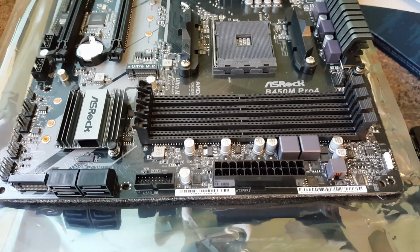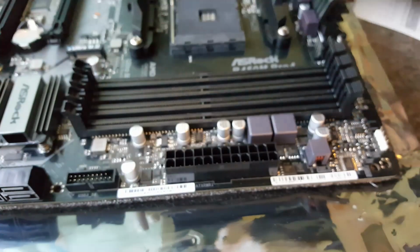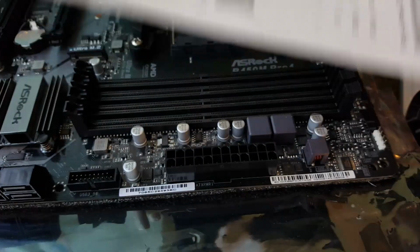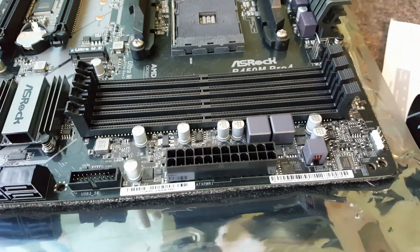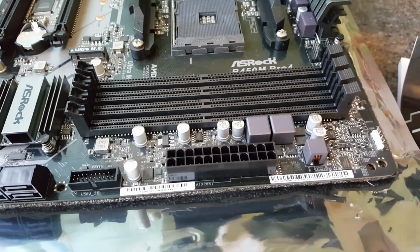Take that into consideration. So before you start putting anything into the motherboard, I suggest you grab your manual and have a look. Any extra pieces of paper, inserts, are usually additions to the original manual, so the logic from that would be that the extra paper bits are going to be more up to date than the original manual.